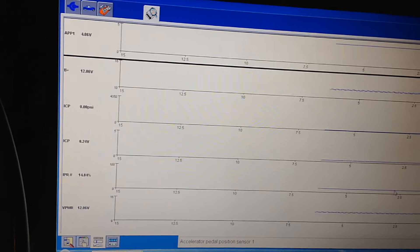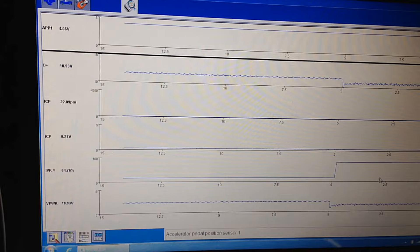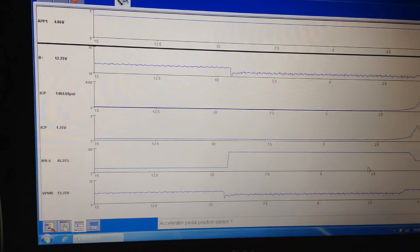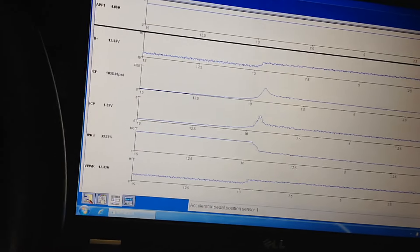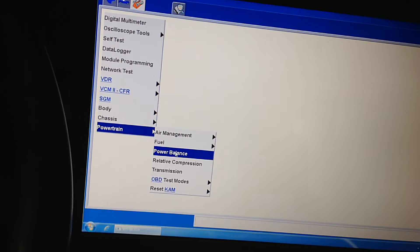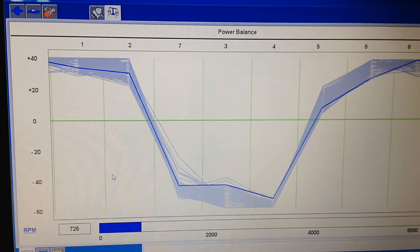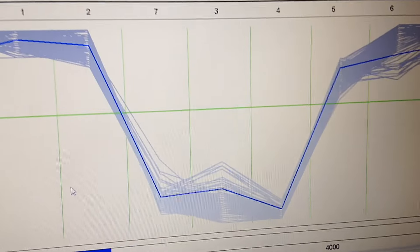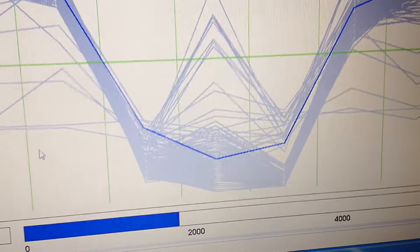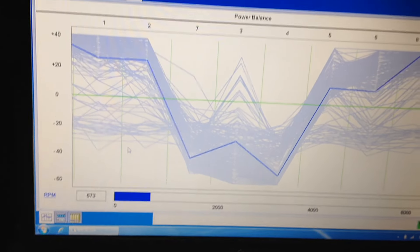All right, we're going to crank it now and see if I fixed it. It's going to take a while — we're building ICP — everything's great, still filling the rail. It's going to run rough for a while and then it'll smooth out. You can see how it's running — one of these cylinders has too much air in it from the high pressure oil rail. Multiple cylinders are misfiring from the air in the system. Rev it up a couple times and they should clear out one by one or all at once. It's starting to come back.